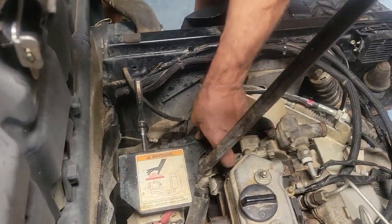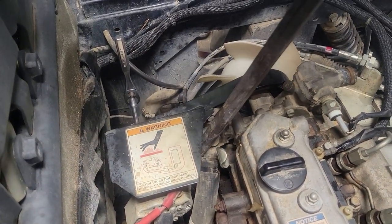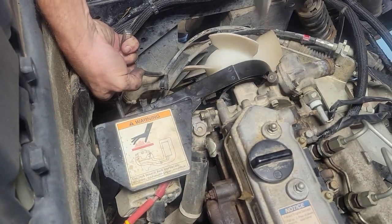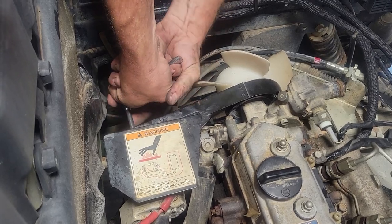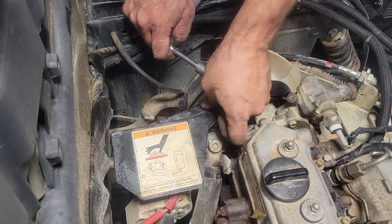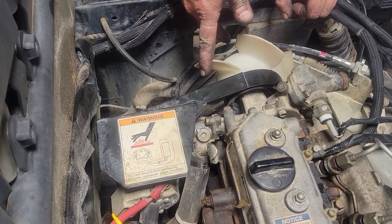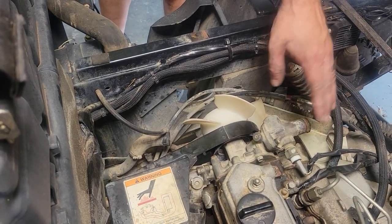So what I'm doing now is tightening my alternator belt — I just use a crowbar and push against the back of it to make sure it's good and tight. Got Joni helping there. This turns the engine, so that's good. So now we just need to get our fan guard put back on and then we can look about getting water in it.